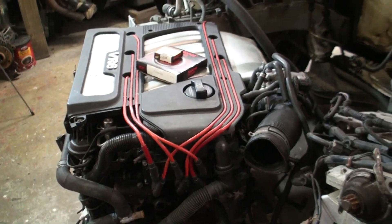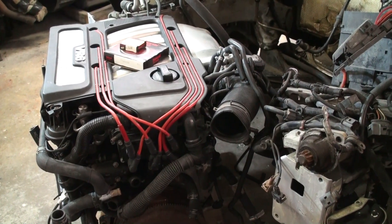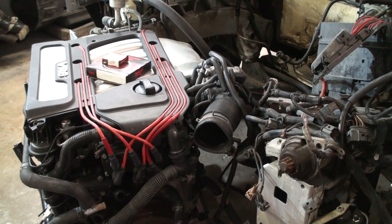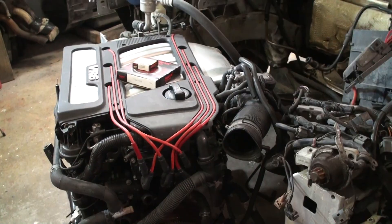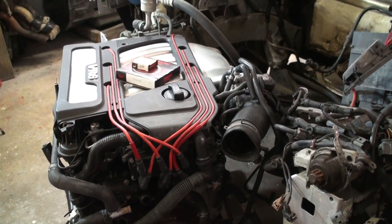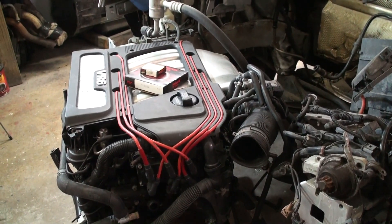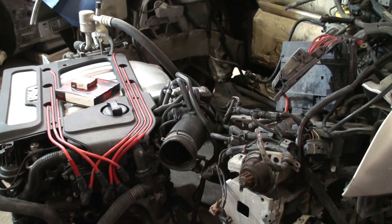From there we're going to change out the intake to a short runner type intake and build this motor for the turbo. First we just get it in the car and running, work out all the bugs, then I'll order forged rods and forged pistons. We're going to run a short runner intake and a polished valve cover to make it look sharp under the hood.